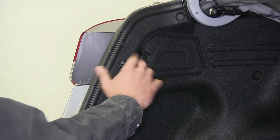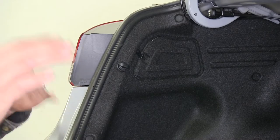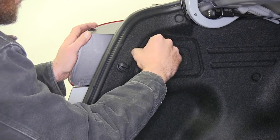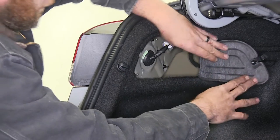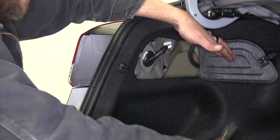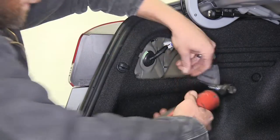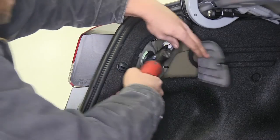Next, we're going to put a couple of pull cables down so when we get our wiring back here, we'll be able to pull it up to us. We need to take out our taillights, so we'll pop open the covers on the back side. Then we have one, two, and three ten-millimeter headed nuts to remove — try not to drop them, because if you do you'll have to pull that panel to get them out.